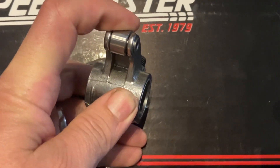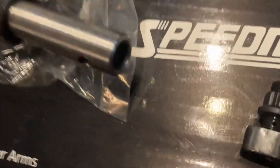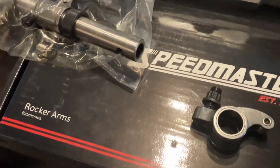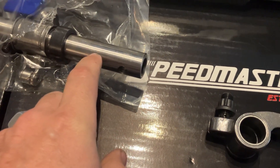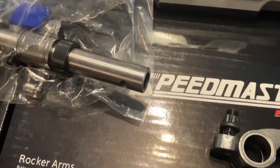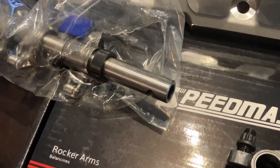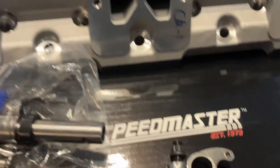The clearance here could be better. The shafts look okay — they've got a pressed-in end. That's not really a selling point because it doesn't take much to do a thread-in end. On the threaded ends, which are common on better-name rockers, you can at least unthread the end and clean it out. So if you had a failure in your motor, you can expose the inside of that shaft and wash it out good before you put your engine back together.